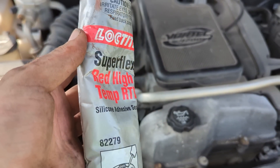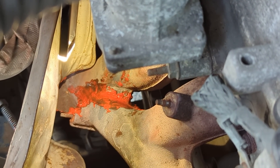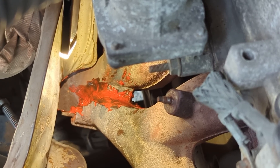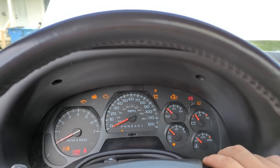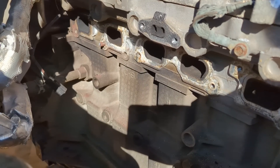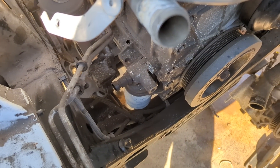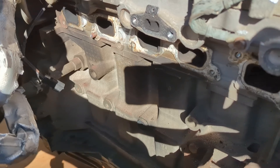I just applied a bunch of sealant down into the crack as much as I could. This is only temporary — I don't plan on reusing this exhaust manifold, I just want to see if the noise goes away. Let's let this cure up and see how it does. After testing, I don't think that's what it was. We are seeing evidence of a pretty serious exhaust leak here, and I'm almost wondering if that's our noise. So I'm going to drop the oil filter and see if there are any metal shavings inside. If there aren't, the exhaust leak could be our culprit.